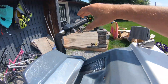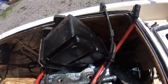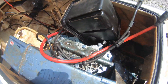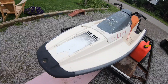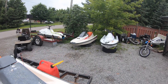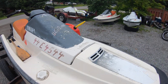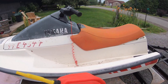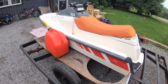I've greased up the throttle — it actually pulls now. I've put a carburetor in it, a fresh rebuild BN38. It didn't come with a carburetor. Turns out this thing also needed a CDI. I took it out of the other WaveRunner and threw it in, and it fired right up. So I stuck a BN38 carb off of a Kawasaki JS440 that was all rebuilt — it's the same carb, so I threw that on.